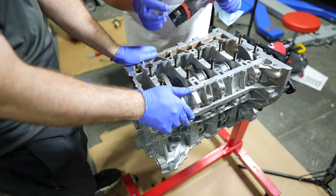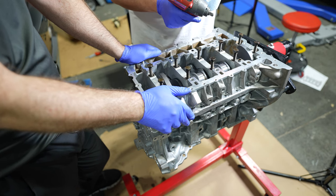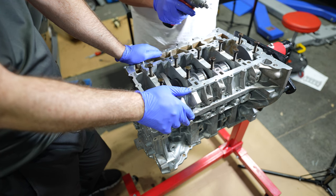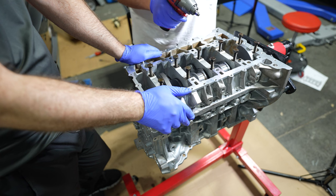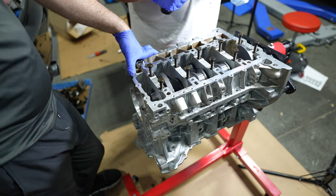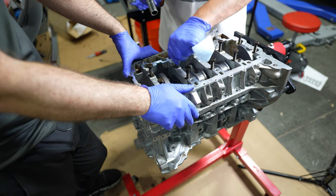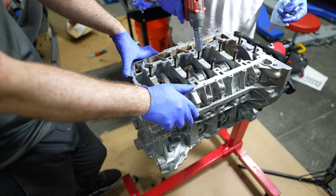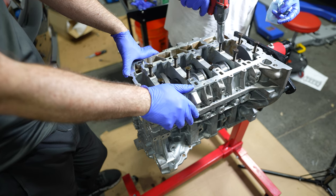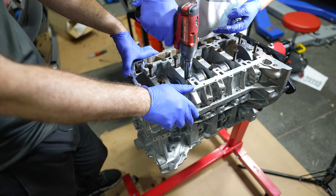Yeah, so this is the M12 brushless. It's the 3/8. It's got the two torque settings. And what I really like is setting one, because it's not very strong. That's only about 8 foot-pounds of torque. So for something like this, where you want to get everything started, but you don't want to over torque it, this thing is really great. And you hear the sound, but there's hardly any torque to that.